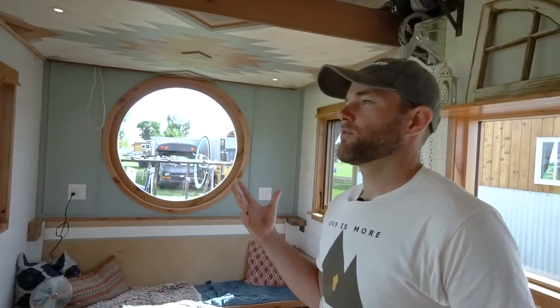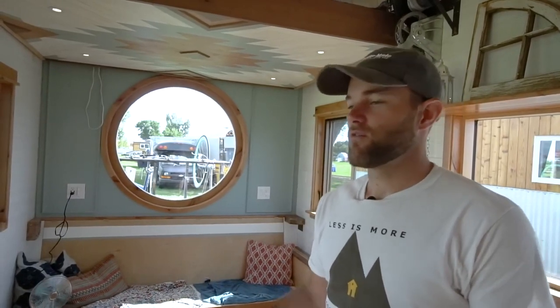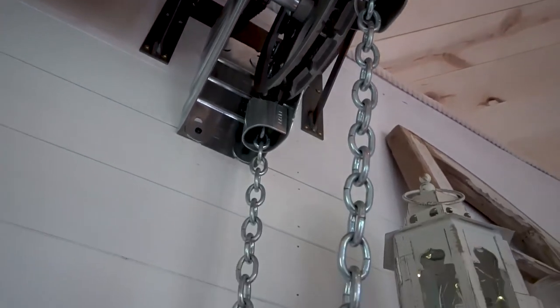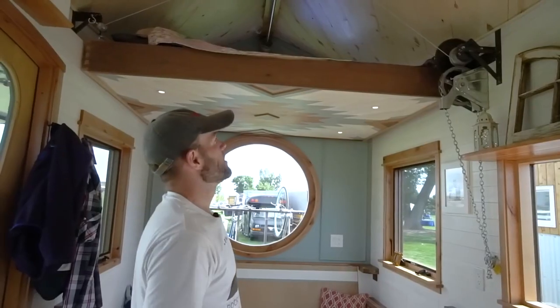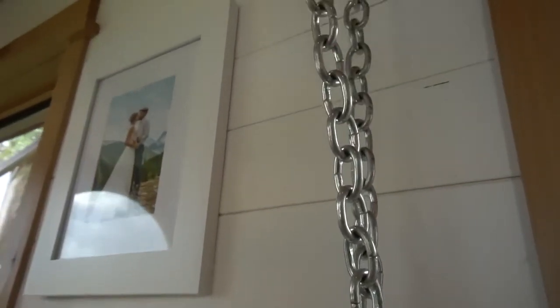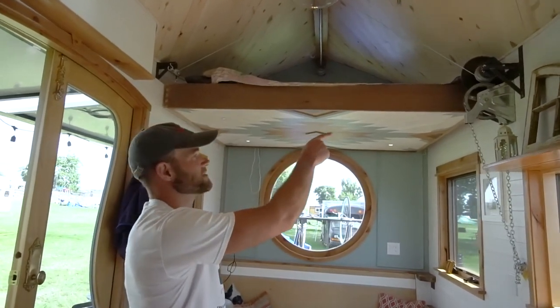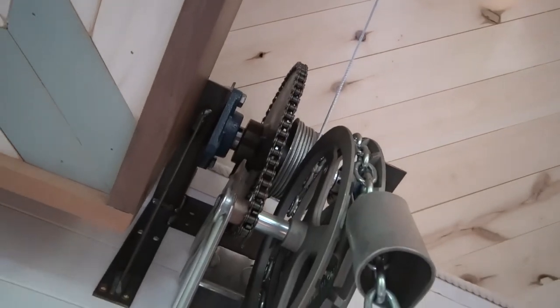Perhaps the most unique feature on the inside is the elevator bed. People have done elevator beds before, and we're not the first. We wanted a slightly different take — most people use garage door motors and motorized systems. We decided to do a manual system, because even off-grid we probably have power, but what if something fails and we're on the road and can't let the bed down? It's all garage door parts — a chain hoist geared down to make it easier, with drums that are just torsion bar from a garage door. All off-the-shelf parts; I had to make some brackets to mount it to the wall.